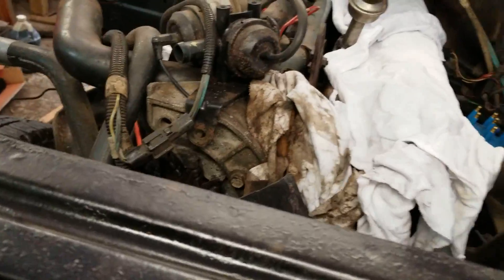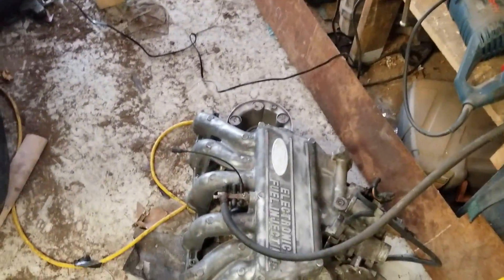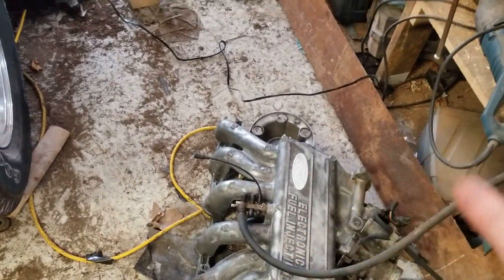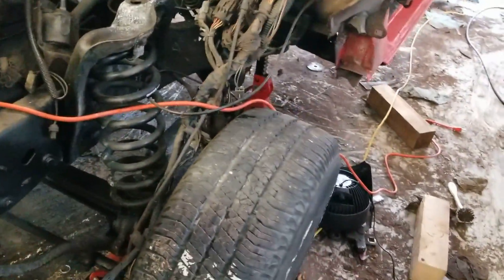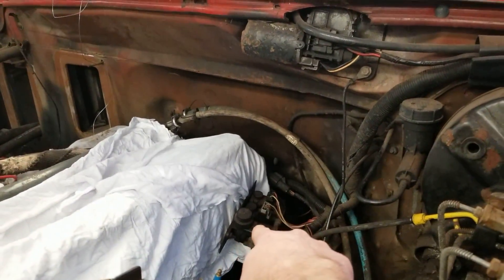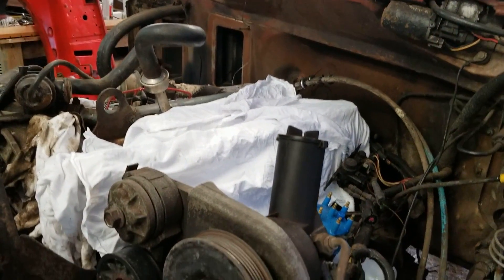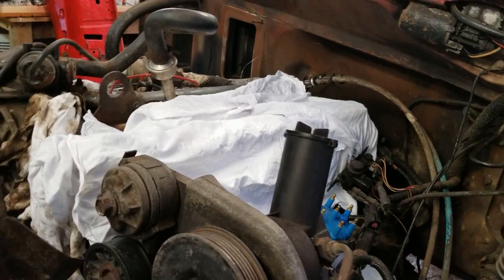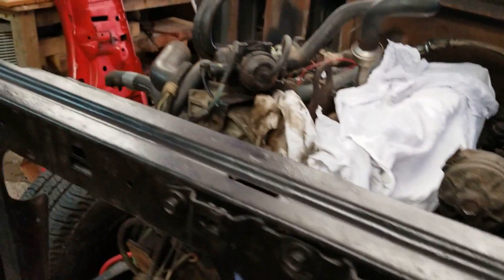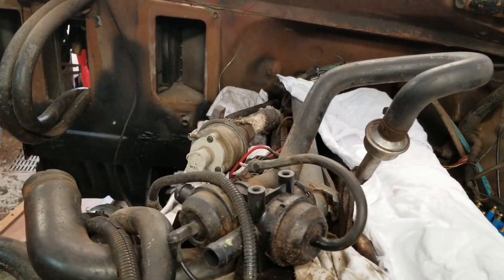Once that's on, we can get the intake manifold back on — that's kind of been polished. I should also get the vacuum lines that are broken from whatever this doohickey is. So once I replace the vacuum lines, we should be able to put the intake manifold back on. I could do it afterwards, but it's going to be easier to see where those things are routing.